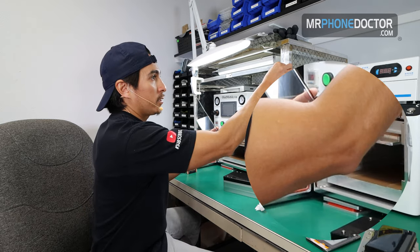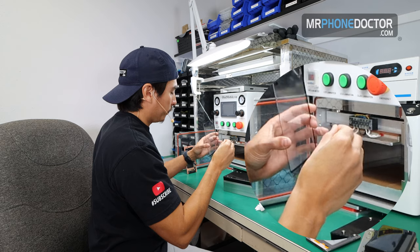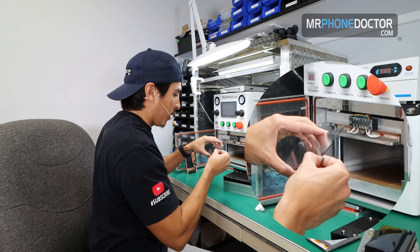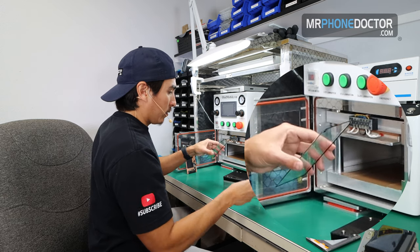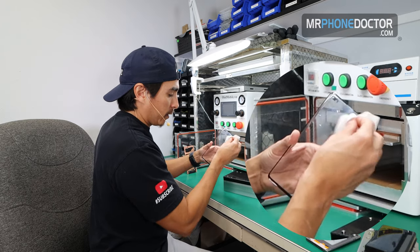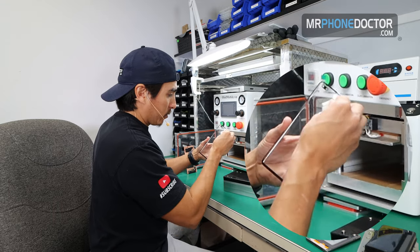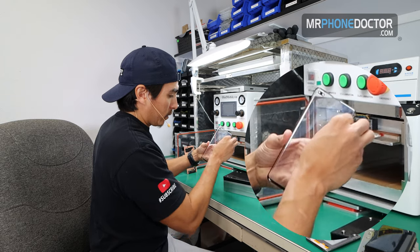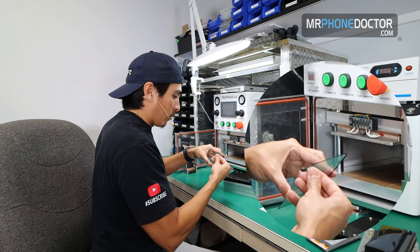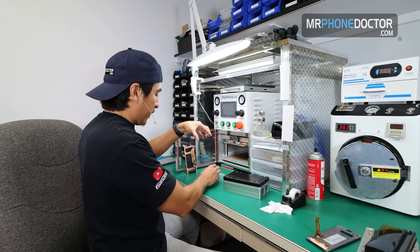I'm gonna go ahead and use this pull tab to reveal. So I'm gonna go ahead and reveal this corner here. And I'm just gonna pull down. And I do wanna make sure that this is clean. You know, sometimes dust particles may fly on this as well, and any kind of dust as you're pulling, the static's gonna end up pulling it. So I just wanna make sure this is clean as well. You always wanna try to minimize any kind of dust. So once we have this here, I'm going to pull it, start revealing the OCA. OCA is revealed, keep it face down.